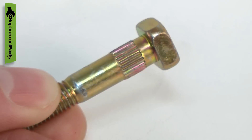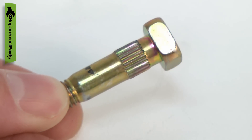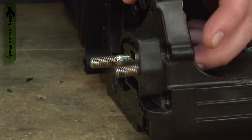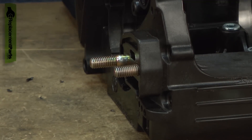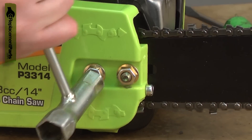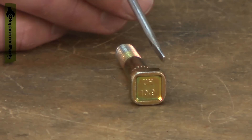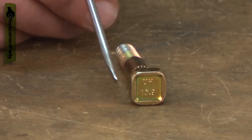Another common problem with the bar bolts is when the bolt itself just spins when you try to tighten it down. This problem is usually a failure of the chainsaw's housing and not the bolt itself. If the bolt is consistently over-tightened, it will put stress on the plastic housing until eventually the head of the bolt wears away the plastic meant to keep it stationary and the bolt will spin.